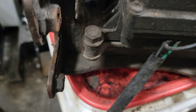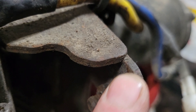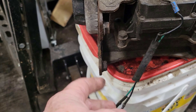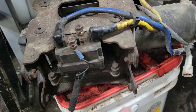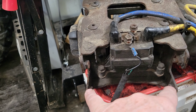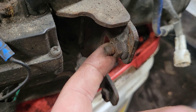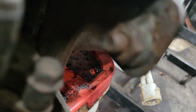Another thing with the winch mount is these guys right here — if you have this thing off as often as I've had it, it's a pain. They did a really fine job of welding these nuts on the inside. You can see here so well that when you strip one, you've only got three holding it. Also, these fingers right here will bend. So when you've got to put it back in, it doesn't want to go back in. Take a hammer and just tap these things a little bit. When you actually bolt it up, it actually pulls it in. So you have to bang these in just a little bit. But this is one of the things I want to take care of as well — I'm not sure if I'm going to be able to grind that off because that is welded.